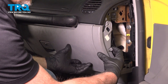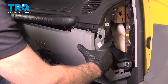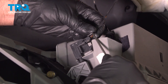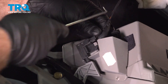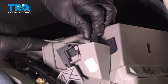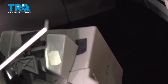On the side panel here, just pop this out — there's a little pin there. The glove box should pull out and you have to slide it towards the right side of the vehicle a little bit. Disconnect these connectors right here — just use a pick and slide up on the release. This one has two releases, two little locks — get under both of those and slide that off, and set that aside.